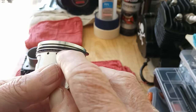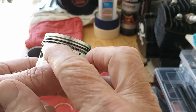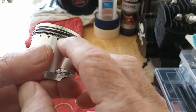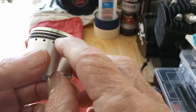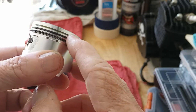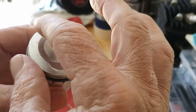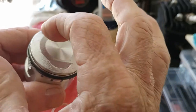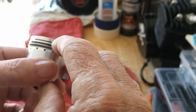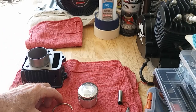I've already installed the bottom oil control ring. It consists of a regular ring, then a baffle ring, and then another ring — that's your oil control ring. There's no up or down on these, they're all the same. When you get to the next ring, this is called the oil scraper ring, and this particular ring has an R on it on the top.